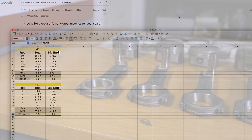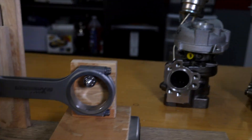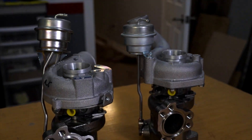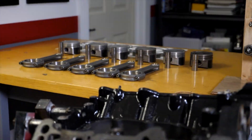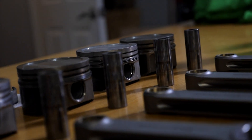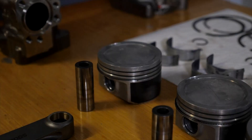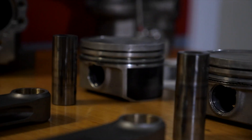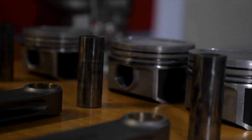It's certainly worth noting that the big end weight of the Max Speeding Rods is about 43 grams lighter than the Audi OEM connecting rods, meaning a full rotating assembly balance check at a machine shop is highly recommended to adjust the crankshaft counterweights. After discovering this weight difference, I decided to have the full rotating assembly balanced at a machine shop prior to putting this engine back together for the second time. This will ensure a smooth-running engine with a long service life.